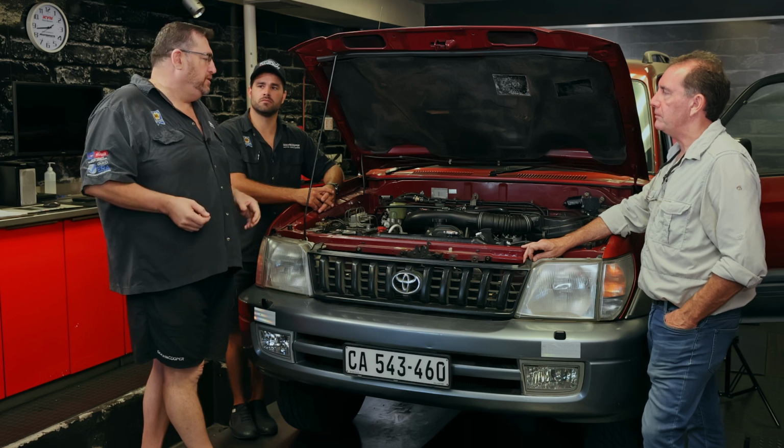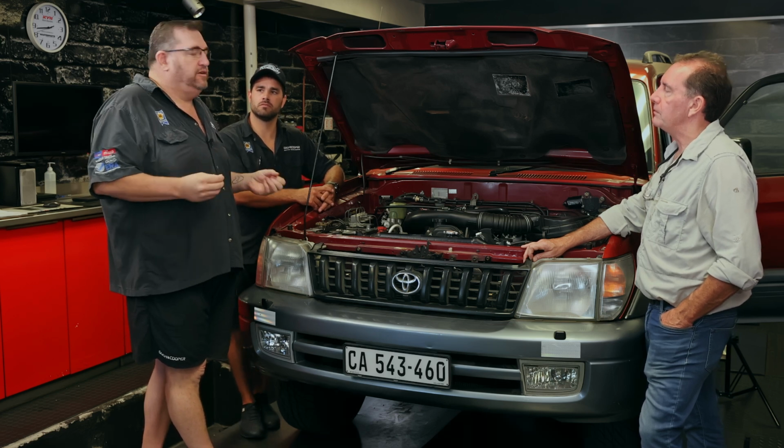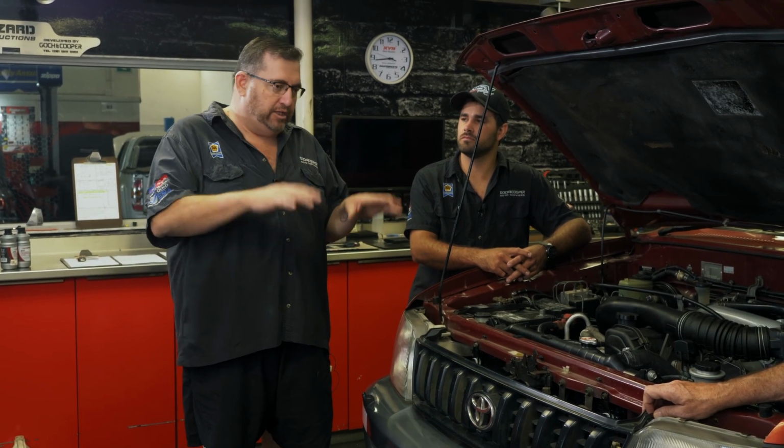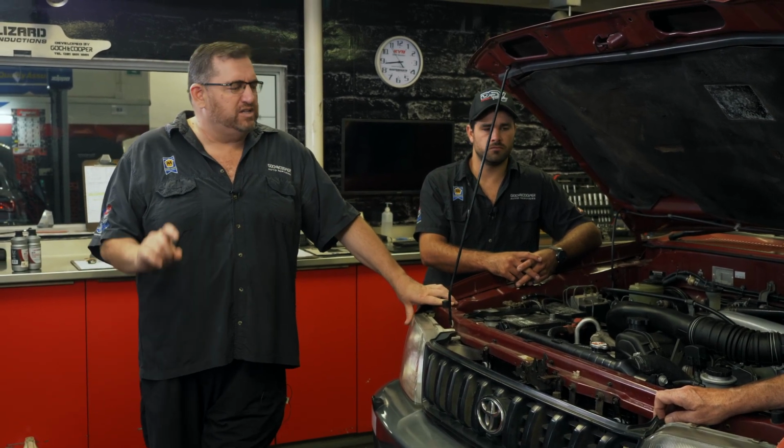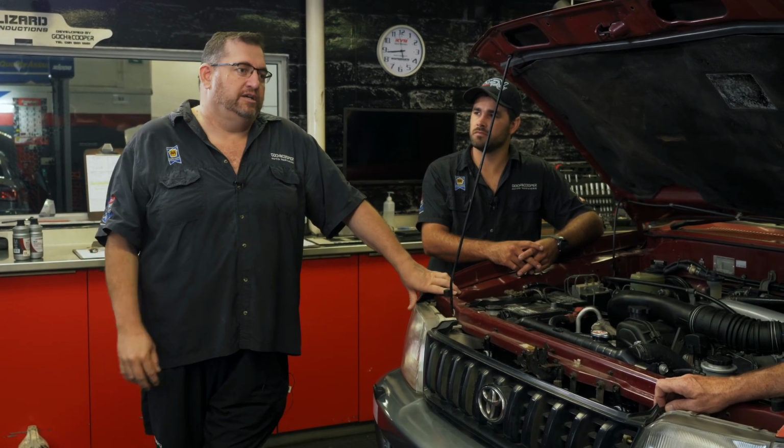Yeah, well, basically there's two different types of bolt. You get a straight bolt that doesn't have a stretching method on it, and that would obviously require torquing. So after basically a few hundred kilometers, let it cool down, torque it, reset the tappets. If it's a stretch bolt, you don't need to retorque. It's also a little safety factor built in, so you can make sure that everything is 100% sealing on the gasket side.